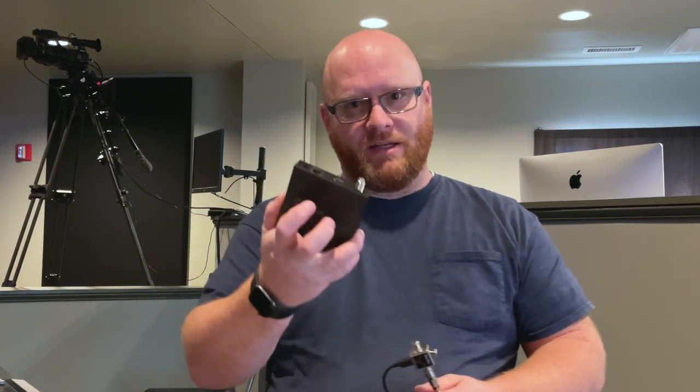When I opened up the package for the antenna, I found several accessories. There were two coax cables of different lengths, and there was also this little device here. Evidently this is an amplifier, and this small section of the amplifier is what makes all the difference. It needs to be plugged into power, so I've got a little USB power adapter, and I've now mounted the antenna — just using an under-counter option. The antenna connects into this little power amp, and out of the power amp it goes up to the HD Home Run device.